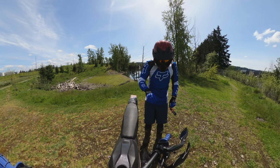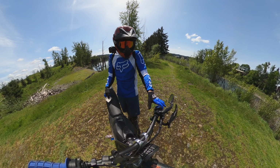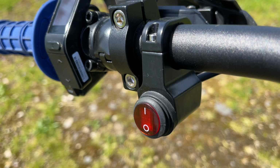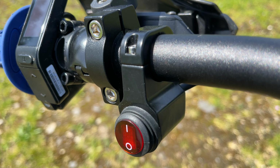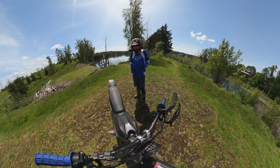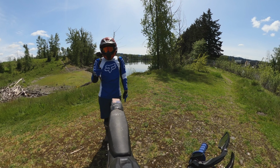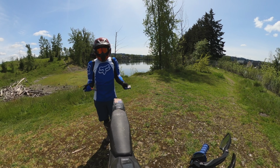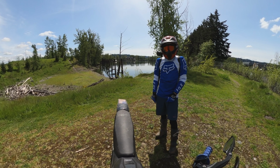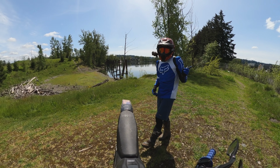All right, guys, probably wanting to get on with your day. So one more thing I did, you guys. And again, this is in the Amazon links, and this is my headlight switch. So I finally put a headlight kill switch, and this is not a plug and play. This is a hardwire unit, but the front is lit up. So it lights up when you turn it on, and then the light goes off when you turn it off. And I wired it into both the front and the back. And I didn't cut any of the stock harness in the bike. I cut the clips on the lights instead. So I didn't have to cut into the stock harness. Just cut the light plugs, and it wasn't that big a deal really. It took me about an hour to wire up, and yeah, it's really cool. I think the switch was only like 10 or 13 bucks or something like that.